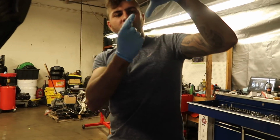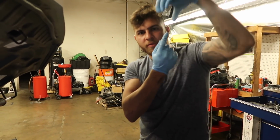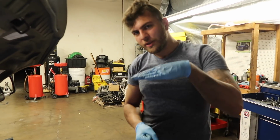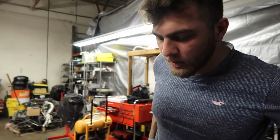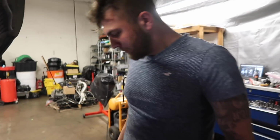because all the wastegate is a valve. If you put pressure on the bottom portion of the valve, it'll lift it. If you put pressure on top of the valve, it'll actually fight that, so it'll increase the boost even more. That's why you see some wastegates have 2 ports, one on top, one on the bottom. The one on top is just to put extra pressure on the actual gate and not let it open up. That's how you can run that much boost.